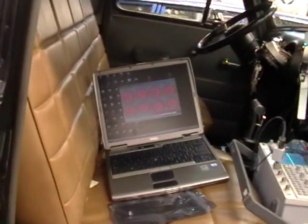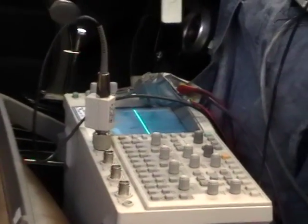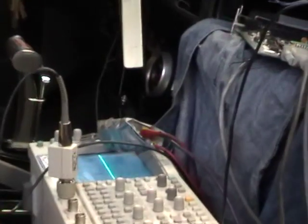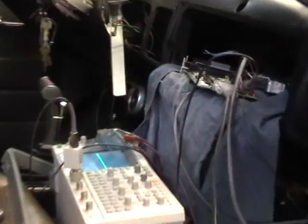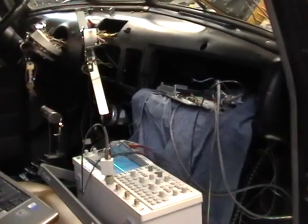Over here we have Megatune set up and ready to roll. I had to set up my lab scope to make sure that the outputs were coming out in the right polarity. That's done — that was just a simple software fix, just a setting change.